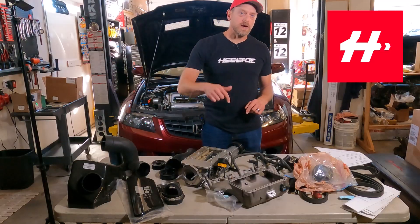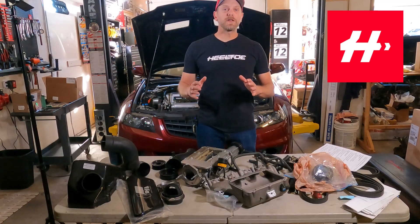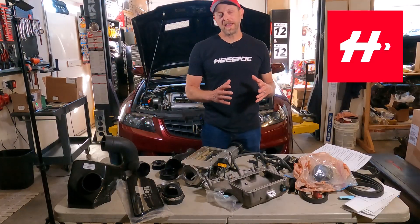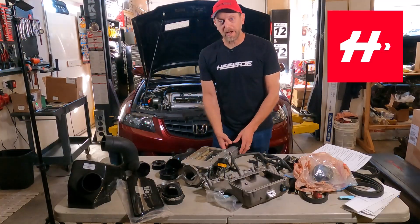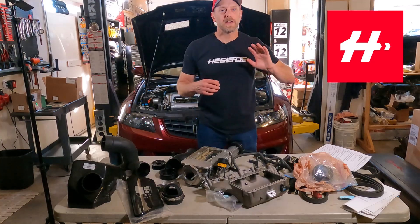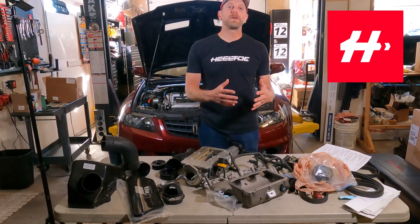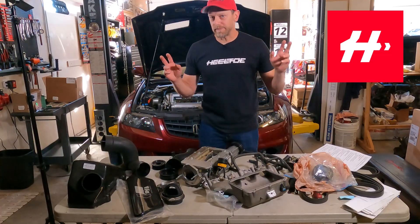If you have any questions, be sure to ask them below and like and subscribe while you're down there. If you're not familiar with what a supercharger kit is — sometimes they're called a blower — basically what it is forces air into the engine. There's a pump that's turned by a belt drive that pressurizes air coming in through the air filter and it crams it into the engine to give you boost, which is a raise in pressure over the air that would normally be going into the engine if you just open the throttle without any boost at all.